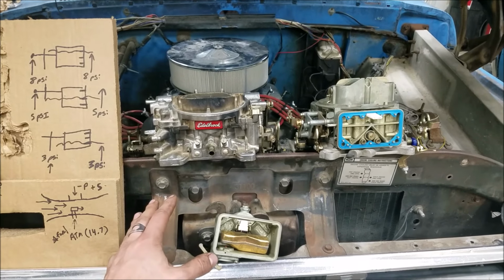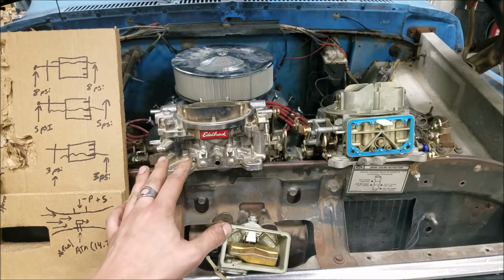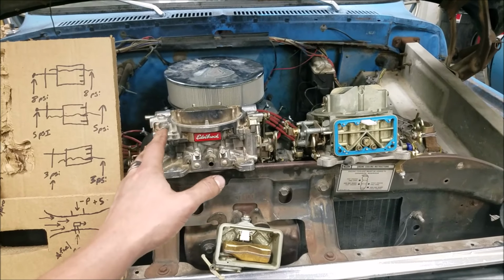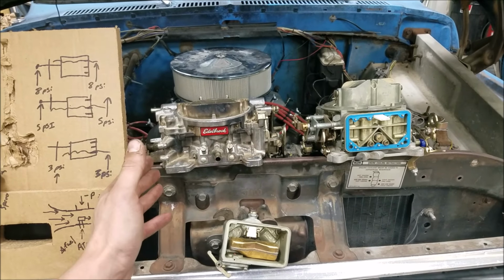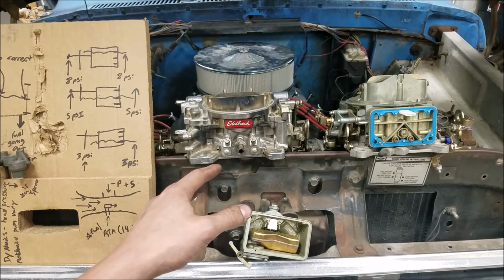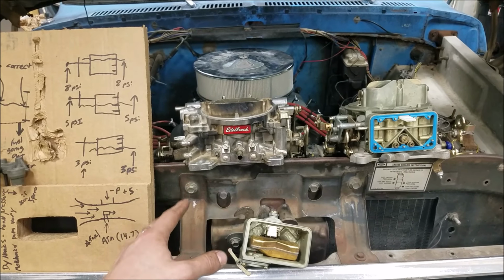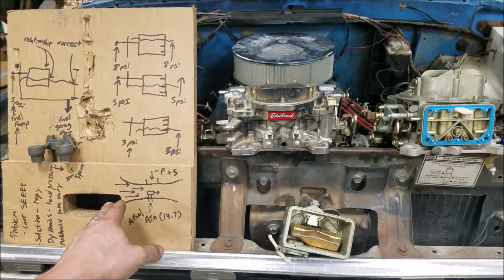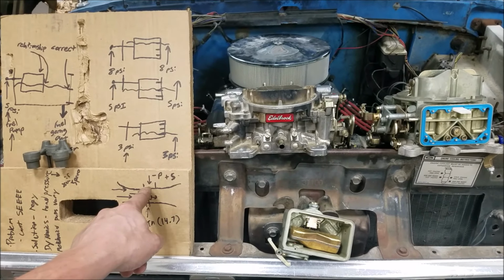In order to understand why variability in fuel pressure causes variability in our overall fueling curve and affects our air-fuel ratio, we first need a very basic understanding of how a carburetor functions. Essentially, they're very basic. They work off the Bernoulli theorem, which more or less states that a liquid will move from a high pressure area to a low pressure area. Duh, everything's going to reach equilibrium. A carburetor takes this a step further and uses what is called the Venturi effect, where as air passes through the Venturi, it's choked down, airspeed increases, and pressure drops.